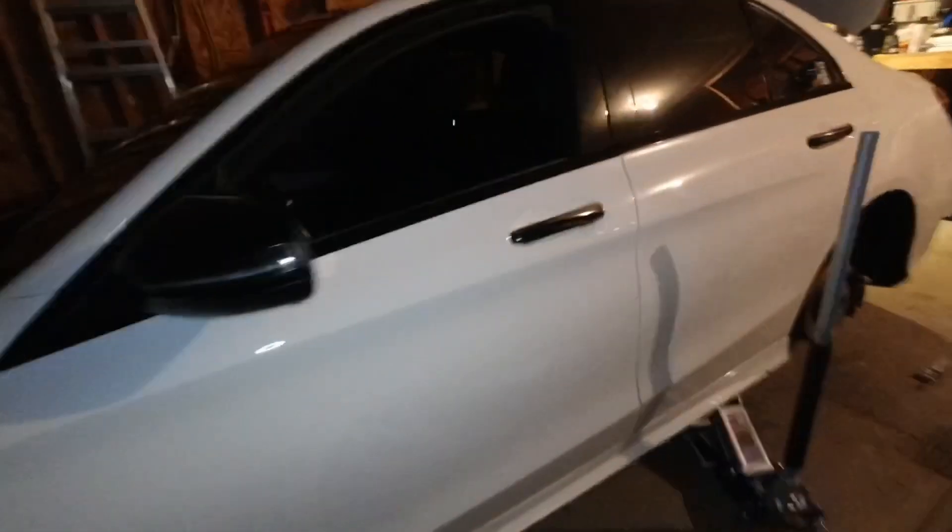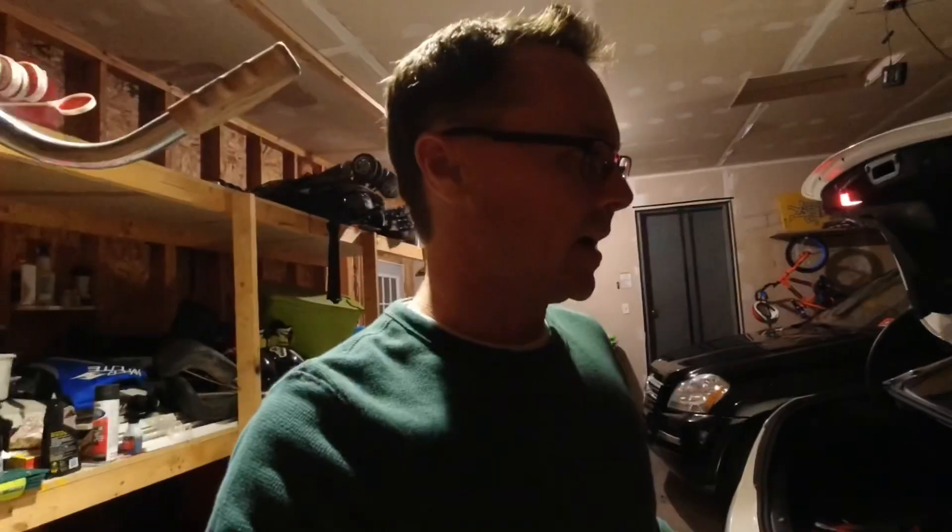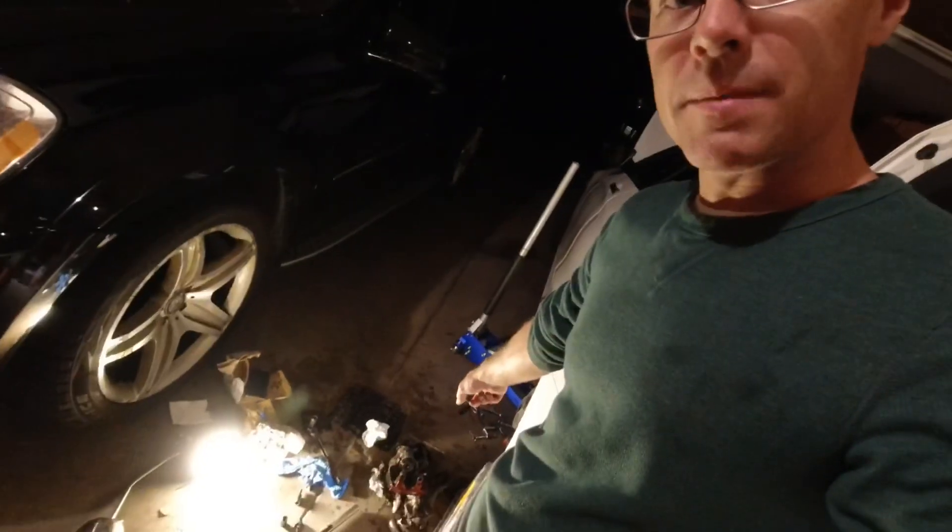Kids are in bed. Before bed I put this car up on the jack stand and took the wheel off, which basically forces me to do the brakes tonight because I've needed to do it for so long and been lazy. So I'm going to knock these out real quick. But this situation escalated pretty quickly - I forgot that this car has this stupid electric parking brake, and initially I thought you turned it off by just turning it off. You don't. I completely destroyed the caliper - it's legitimately all the way off the car.